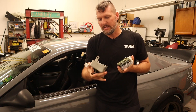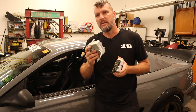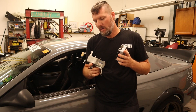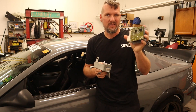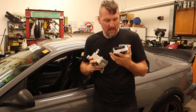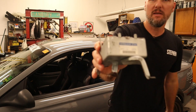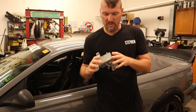For the casing I had cut off the brackets and welded on new ones to make it work in the car, and in my laziness I didn't remove the ECU first. I didn't realize how close the control board was to the casing. In my welding — I was trying to just do little tacks — one of the tacks did go through and burnt a section on the board. It didn't seem to cause total failure since the power steering still worked, but there were some inconsistencies going on. So I put in a new ECU and things are going pretty well. I'll show the part number for the second-gen Toyota Prius ECU in case anybody needs it.